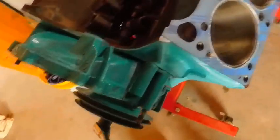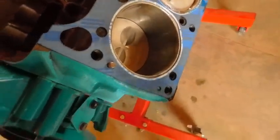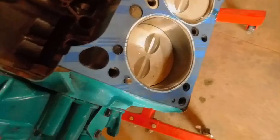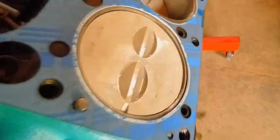And the second one up is the exhaust one for number 1. So now we're coming around. So we have compressed the mixture. And so now that can only mean that we're very close to somewhere around 6 degrees before. And that's going to be close enough, because I think it's more than that. And you can see the piston is down a little bit.